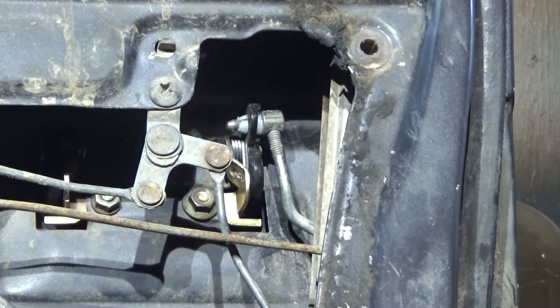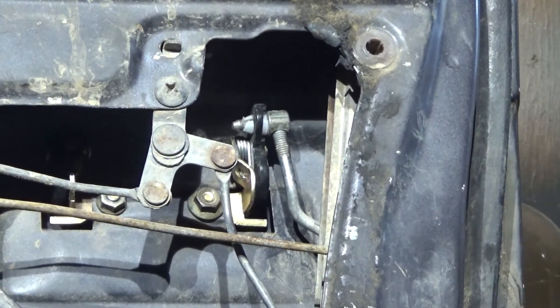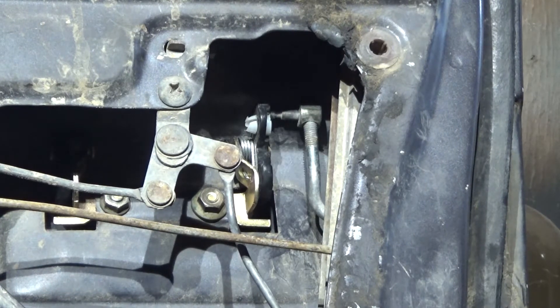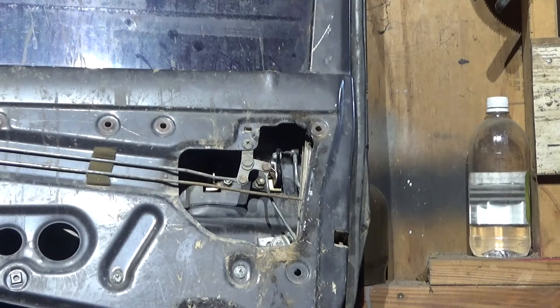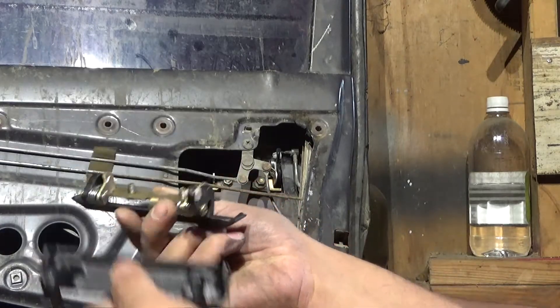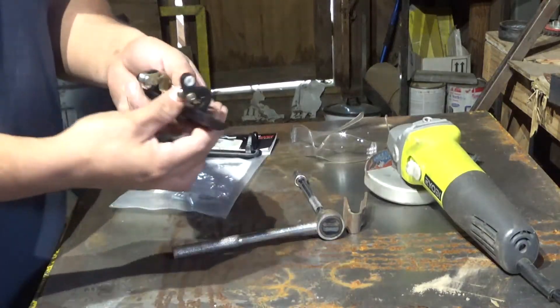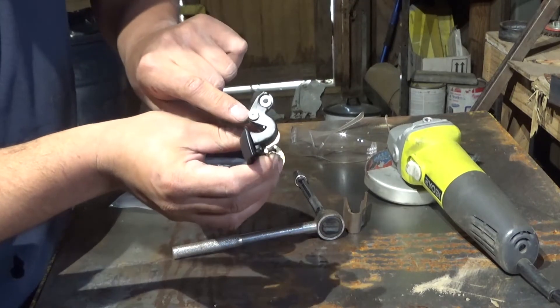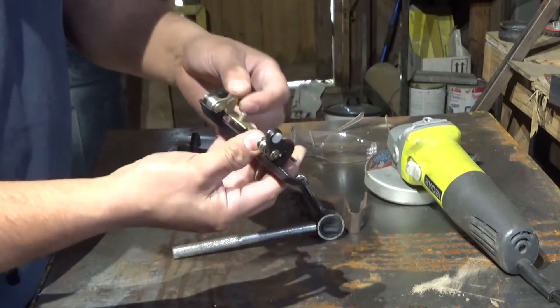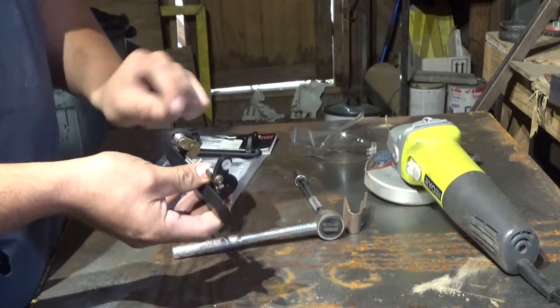Having to take it on and off so many times to try to clearance it and do all this, you run the risk of scratching your door up. Mine doesn't really matter because it has ugly paint. Since I threw away my original door handle - and by mistake I threw away the bracket and everything - I'm going to take the bracket from this eBay handle and put a low range handle on it and see how it works. The way you do that is you have to grind off these rivets - well, not rivets exactly. You just have to grind the flat part off, pull the pins out, take the handle off, and keep the springs because you're going to need them.